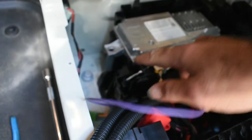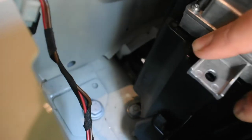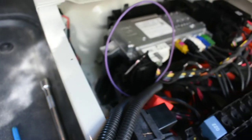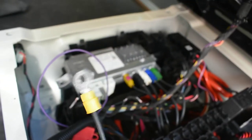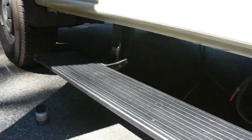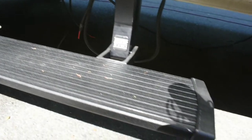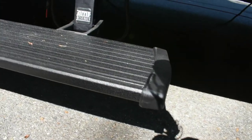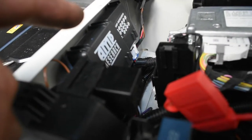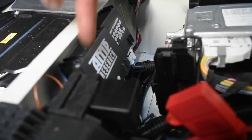So I put the terminal loop end of the fused link of the power step harness onto that stud. Then while you've got this piece up, if you pull it just to the side a little bit, there's a chassis ground right there. So I'm going to ground this harness with the black wire to that stud. And then just like the passenger side, once you've got all the brackets bolted on, you bolt the running board onto the brackets.